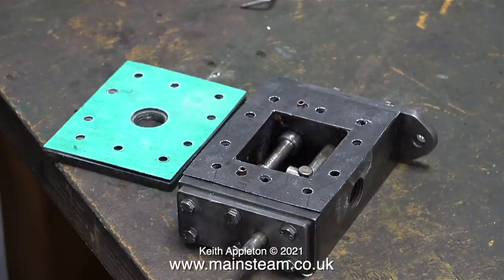For the gasket that fits between the steam chest and the cylinder, I had to make two more holes to accommodate the small pipes that connect the ports together. I also cut out the centre of that gasket — if you leave a lot of gasket loose inside an engine, after a while it can start to fall to pieces, and small pieces of gasket can block the ports.